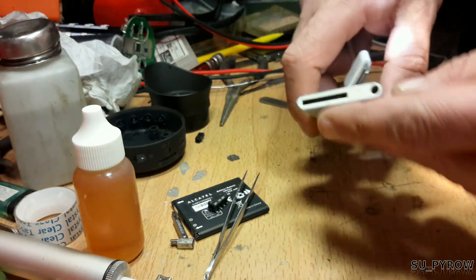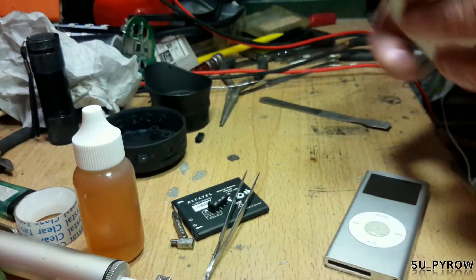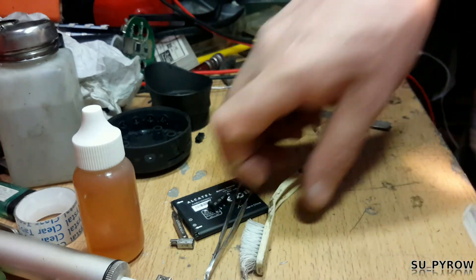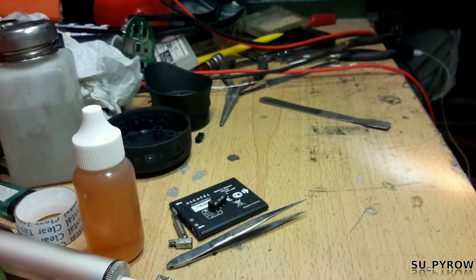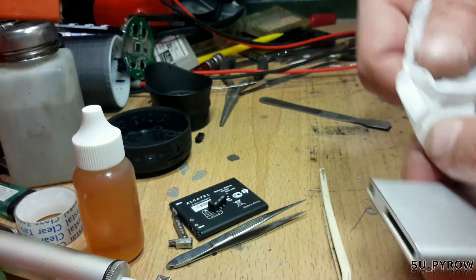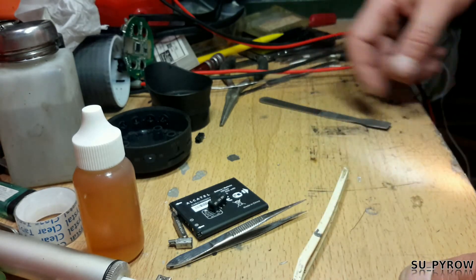The other thing wrong with it was the internal connector. The fix: I took rubbing alcohol, smeared it in there, took a toothbrush, rubbed back and forth, then blew it out with compressed air. That took a few tries but it's spotless. You can also verify by sliding coffee filter paper in there — not tissue paper — like you were cleaning an old Nintendo game.